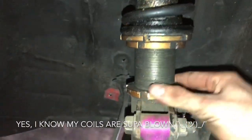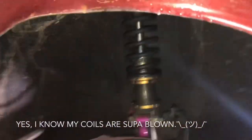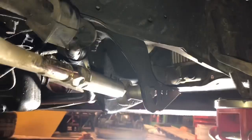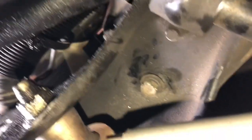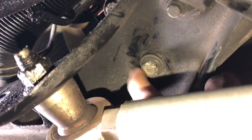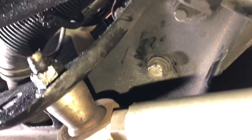First things first — I already handled this one, but my coilover actually knocked itself completely loose and raised this corner about a quarter inch over the driver's side, so it was getting all types of crazy camber change because the collar was loose. Right here we have our tension rod, and if you look up top we have the mounting bolt for the tension rod bracket going into the frame. I was poking around and noticed this guy just kind of does that now — it's completely encapsulated in the frame, no access holes on any side. Don't mind my power steering puking, that's another thing I just found.